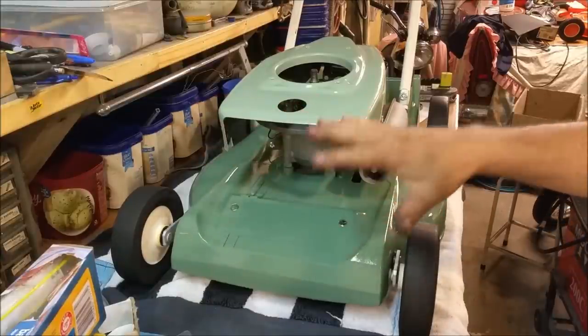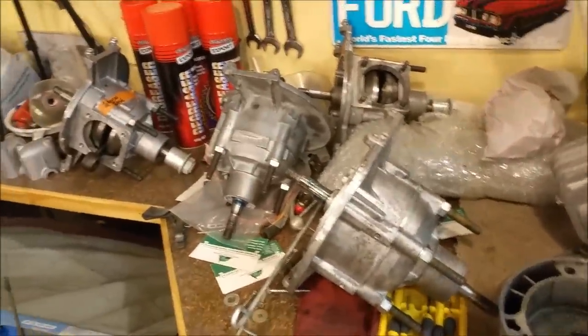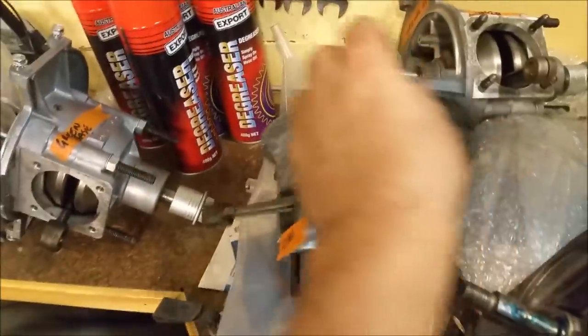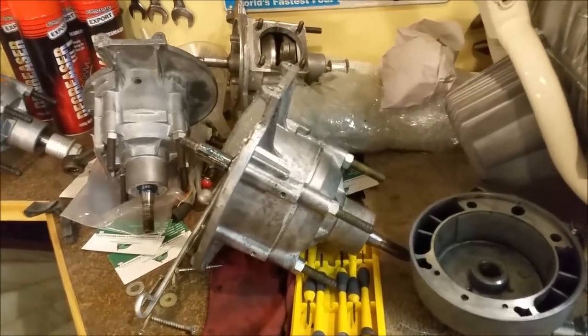Of course we've got the hood that goes on the front, so it's a very heavy set in terms of body work. But this is a great engine — it's got new rings, bearing seals, as we've done with the rest of them. We've got these ones waiting, and I've labelled which ones they're going on. This is the new crank on the 125, so it's going in the little dark blue Starlet one. I haven't hydro-blasted these cases — I don't think it needs it. There are 125s and 160s in various states. The rest of them are 160s, and we should be pretty good. I'm fairly happy — I'd say I'm really happy with what's going on.